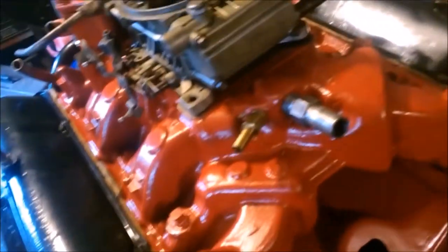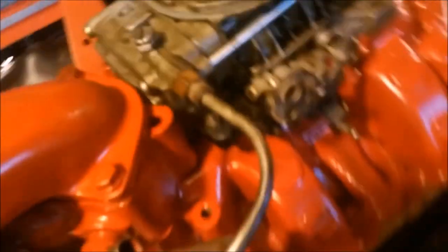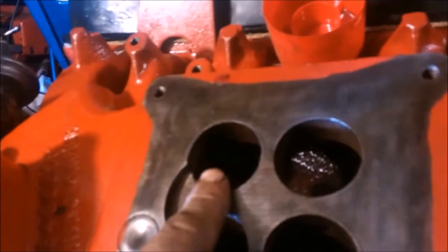One problem is some of the later ones will have an air injection port where a pump would pump air back in the exhaust and another port would pump exhaust fumes back in. Just like we took the stuff off our alternator bracket and power steering pump bracket, we don't want to put them on until afterwards due to clearance issues. The Scout for the power steering pump had another pulley bolted on here. We'll have to put the different fan on because this older fan didn't have that pulley and the belt will hit. After cleaning up our best fuel pump, right back in there where it was — little gasket shellac on the surface of the gasket that meets the pump.